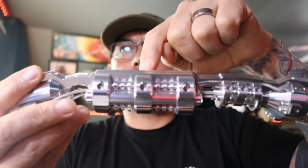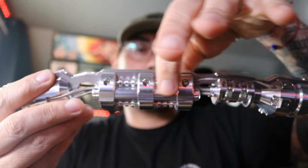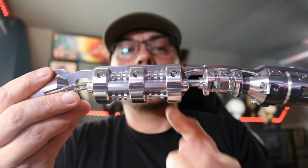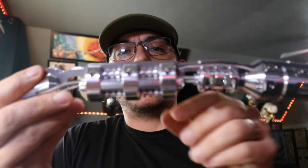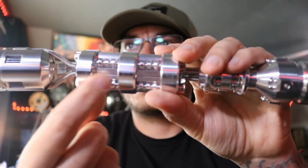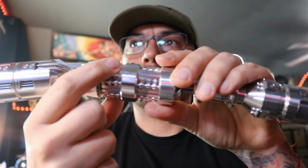You're going to want to do the same thing with the middle one. Take off that screw and that screw, slide this all the way forward, take it off, and then these 4 greeblies will come off. And then there's a little spline piece right here that runs from here to here. That pops off, and that allows you to take these 2 side panels off.